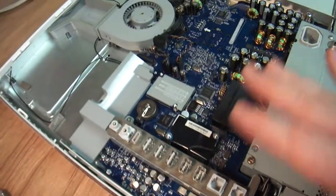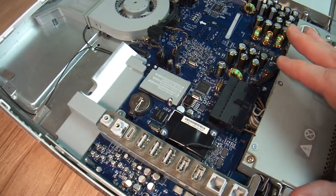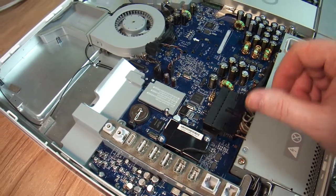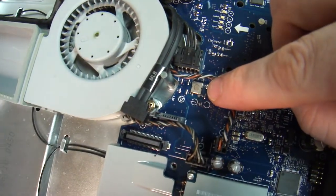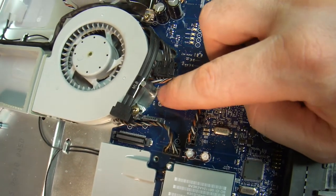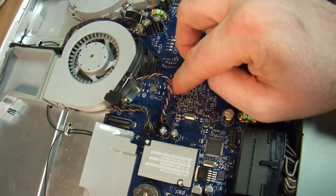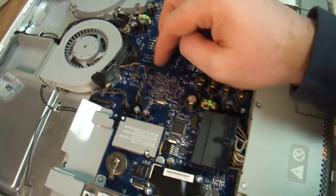I've researched the board and I have not found anywhere on the internet or on the board any shortcuts or terminals that I can just short to eject the disk. I did find a couple of buttons on here — these buttons are for turning the computer off and on. It looks like two of them are missing; there are three buttons designed, two are missing, one is for turning the computer off and on. I tried to short the other terminals and they do not eject.